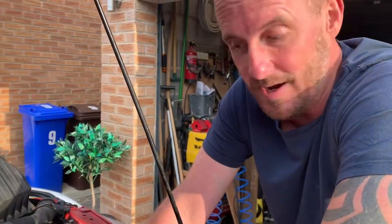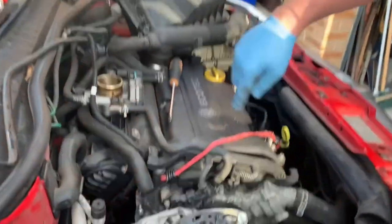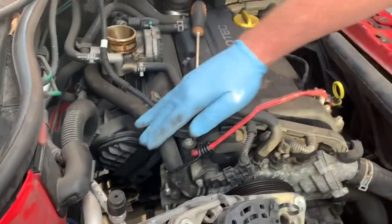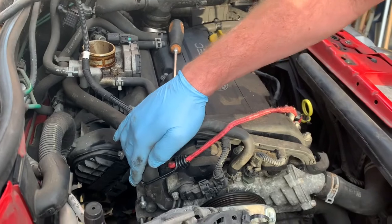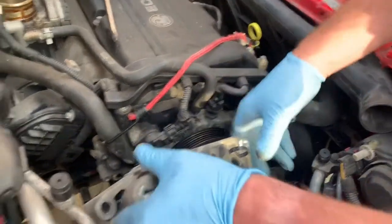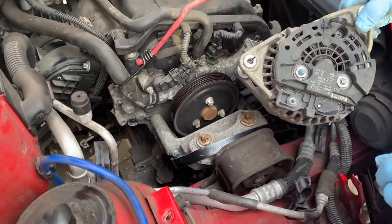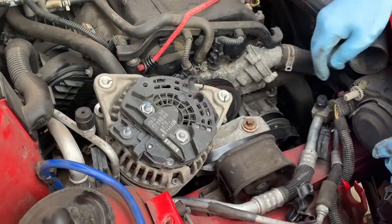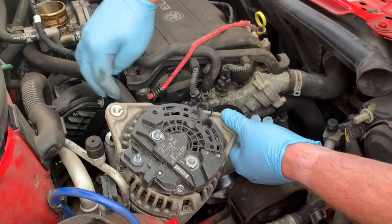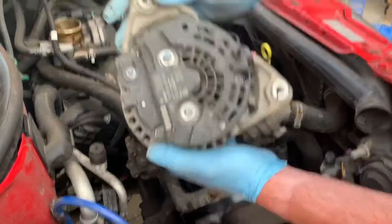That was a bit of a pain to get out. You can't drop it down the bottom, so I've had to take it out the top. To take it out the top we just have to take a few bits off. There's a channel here which goes across the top of the timing gear cover — I had to take that off and just move it to the side. Then using a bungee just to pull that water hose back enough, and it was hanging up on these bolts here, so I took out those two case bolts. I also had to undo the clips that held the aircon pipes in just to free them up a little bit for freedom of movement. It's a bit of a wrestle, but eventually it came out in that direction. There's another video on YouTube where the guy actually drops all the suspension to take it out — so yeah, it's tight. So that's it out.